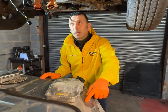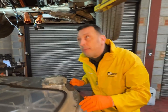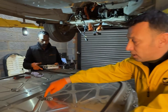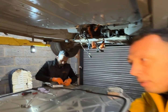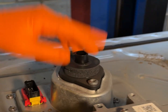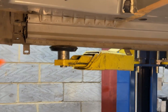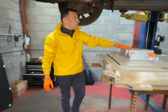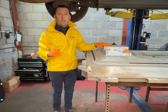To remove the high voltage battery, we also had to remove the interior — the seats and the rear back seat. The seats have four securing bolts, so we had to remove the seats and lift up the carpet to access them. To access the service connector on the battery and isolate it, we had to remove the back seat. The interior is quite dismantled for this job — obviously including the lower-side high voltage connector and the cooling hoses.